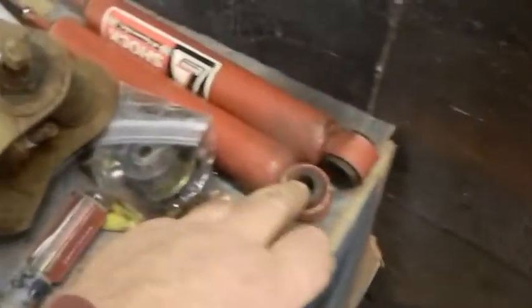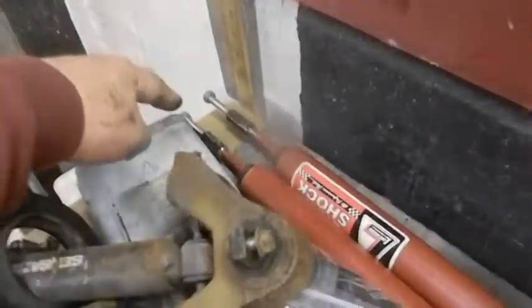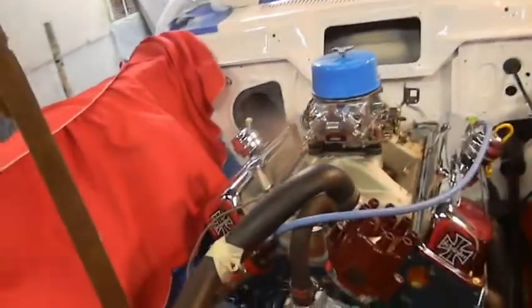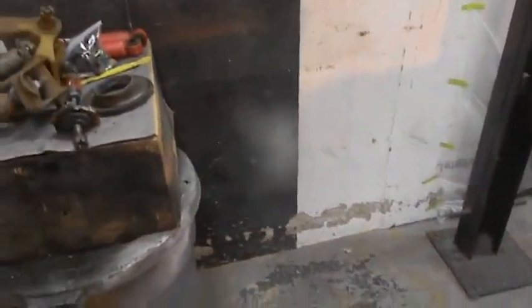I'm not in the mood to lay under the back right now and put those shocks on - I'm going to do that when the front end is down. These have more mileage on them laying in the box than on the actual car. These are different than the new Lakewoods. When I got them from the guy he gave me all the bushings, everything, and the shock extenders. The reason you need the shock extenders is when these cars launch, the axle actually comes down out of the car. If the shock is too short it keeps it from coming down - you need it to push down to the ground to get traction, especially the right rear. I got these from the same guy I got the pump from, the distributor, the tranny, and a bunch of other things.